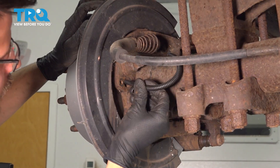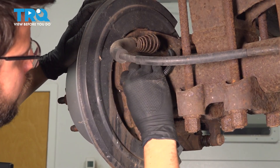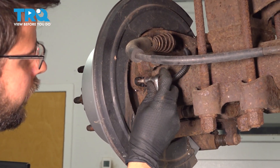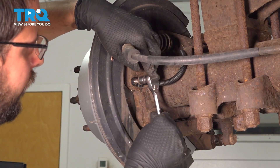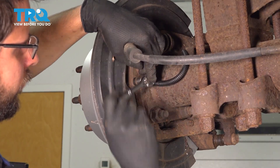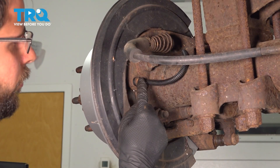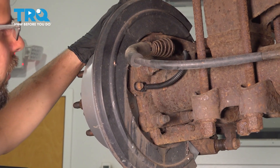Take the new one and slide it through. Make sure it fully bottoms out and lines up. Slide the bolt through and start that on. That's bottomed out — I'm just going to give it a little extra. That is plenty tight. You don't want to break the plastic that goes around here that mounts it. There you have it — the ABS sensor is replaced. For this job, you don't actually have to remove the wheel; you can work around it from the backside.